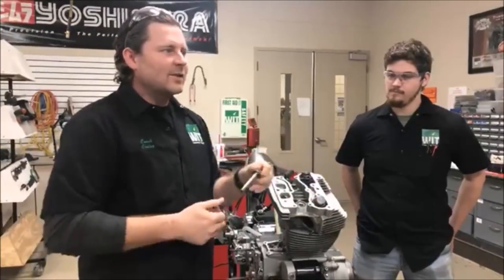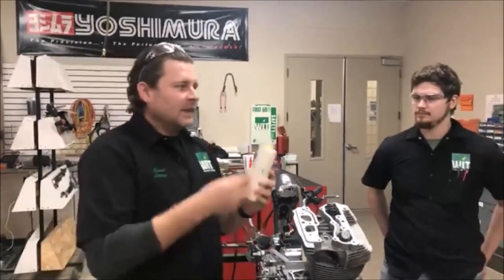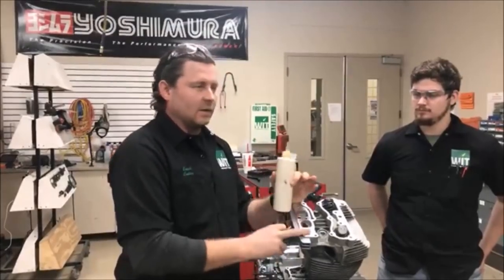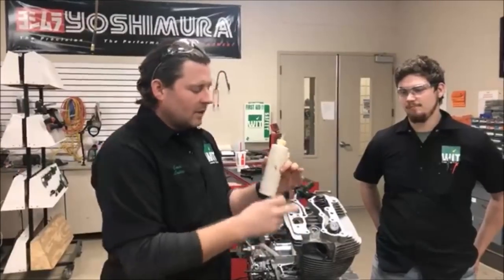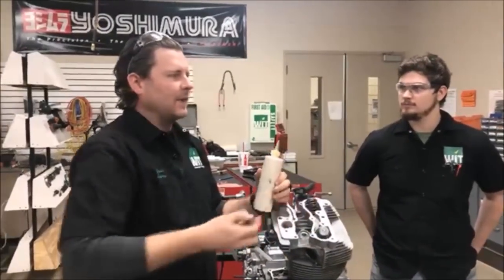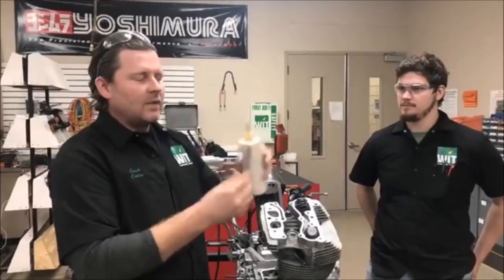So this is another reason we got talking, is that the other thing about fasteners and nuts and bolts you have to understand is what you're doing. And I was telling a story where I had a tech one time that put a motor together for me and it failed and the head gaskets were leaking. And it sucks. Warranty work sucks. Comebacks suck. And so when we went to go ahead and take that motor back apart, the head bolts weren't kissed all the way down. There was like a gap in there. I'm like, what the heck? How could that happen? Well, what we were learning is that tech, instead of oiling the threads, was just pouring the oil in here. And now we got a whole nother thing.